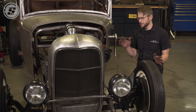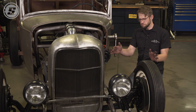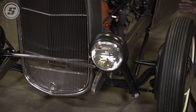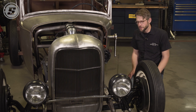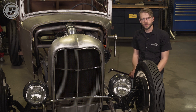Now we talked about having the steering centered and the wheels pointed straight ahead. We also have the car at ride height. This is a great time, before you commit to ordering this length, to look at any variables — anything that could change that would affect that measurement. In this case we're pretty confident in that 38 and a half inch length, so we'll go to the Speedway Motors catalog. For this particular length we don't have an off-the-shelf kit that is correct for 38 and a half inches.